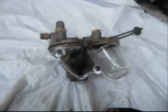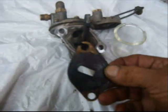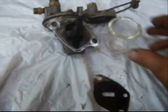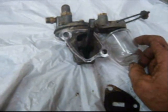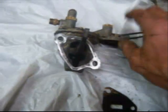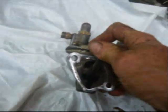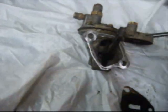I took the fuel pump off of this truck because I wanted to clean it up and make a new gasket for it and just kind of see if it works. I cleaned it all up and was washing it in a pan of gas, and I put the part where the gas goes in underneath the gas and started working this lever that works the diaphragm inside, and sure enough it started to squirt fuel out this end. That's how that works.